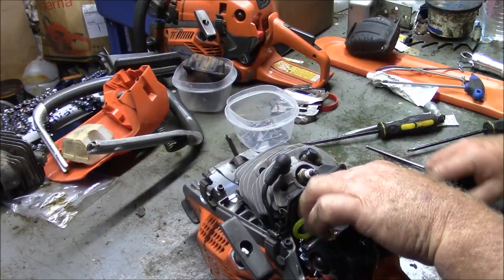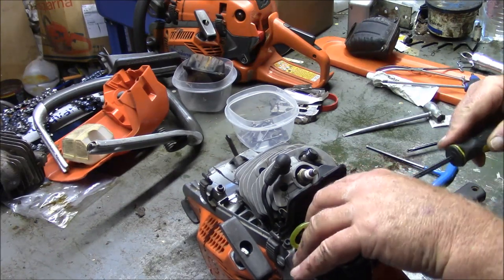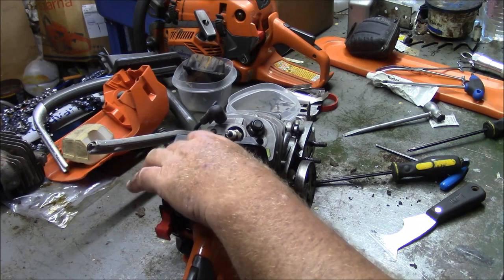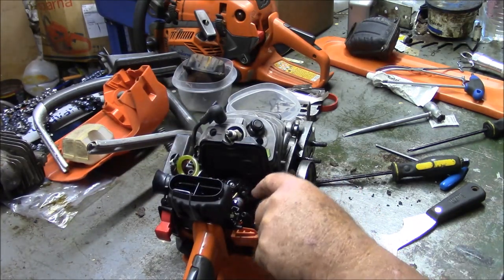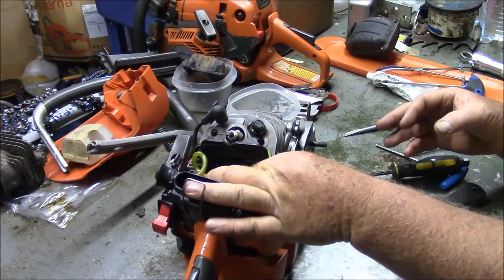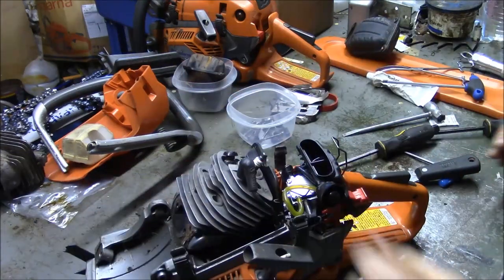When you pull the carburetor out, you got to pull it away from the fuel line. It's going to pump out. See, it was under pressure. That's good news. The reason why that's good news is it means that there's no degradation of those fuel lines. And I've pretty much found these to be in good shape. I really haven't seen any degradation issues, even on the older ones. The other thing you got to do is pop the fuel line out of that little bracket right there. At some point, I got to get the throttle cable out of there, too. Well, I'm going to pull the cylinder up a little bit before I get to it.